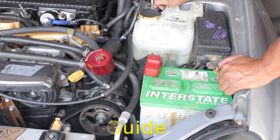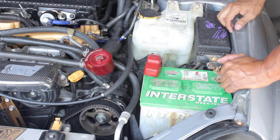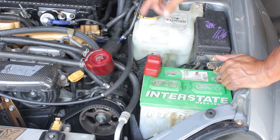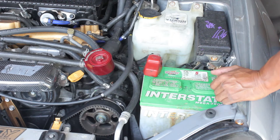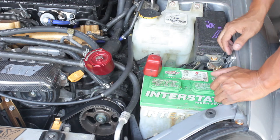A guide suggested removing all spark plugs before doing a compression test. I did a quick test first and the gauge didn't even move on cylinder number three — it didn't move at all. I started laughing actually. I'm going to remove the spark plugs on this side and do a proper compression test on all four cylinders, but I'm a hundred percent sure this engine is gone — that needle didn't even move.